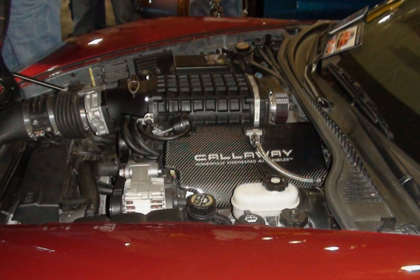LY6 Applications: 2007–2009 Chevrolet Silverado HD; 2007–2009 GMC Sierra HD; 2007–2013 Chevrolet Suburban ¾ ton. The L96 is essentially identical to its predecessor the LY6, with the primary difference being that the L96 is flex-fuel capable while the LY6 is not.